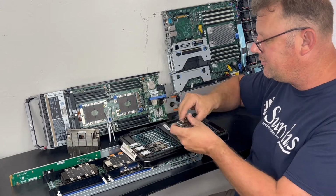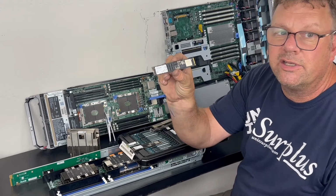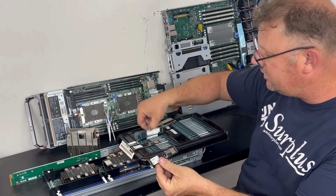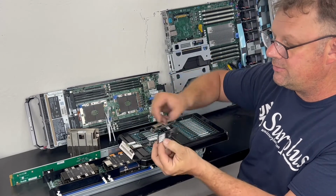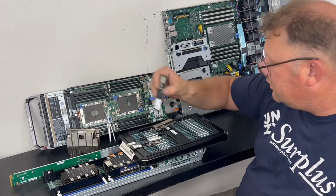Where you take a look at Samsung, yeah, they still got a little bit more power efficiency, so they don't need as many power capacitors over there. They got a good controller, so a few less chips than what Toshiba needs over there. Toshiba, to make a 2 terabyte, has 1, 2, 3, 4, 5, 6 large chips, whereas Samsung can do it only in 4. So those are the differences.